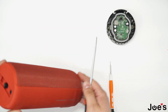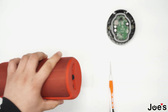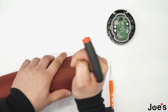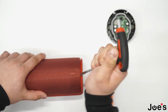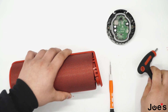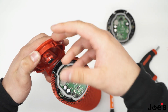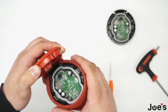You start out by going to the charger port side of the Megaboom and prying up right about a quarter of the way from the center. As you do this, try to be careful not to completely damage the clips, because if they get damaged this thing won't be able to clip back down and provide a secure hold for the whole spine of the speaker.